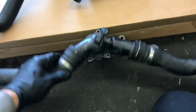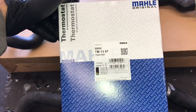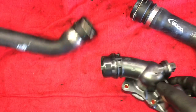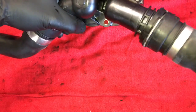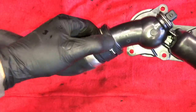Now assemble the thermostat and upper and lower hoses together. I'll link the part numbers for the thermostat in the description. Take the new hose, lubricate all the seals with liquid dish soap, and assemble the upper and lower hose. Line it up with the thermostat — there are little clips — press it on until it clips and give it a little tug. Note that the new hose has a new sensor built into it already. Line the tabs up, push them on until they lock into place and click.